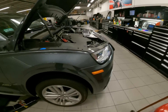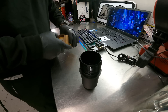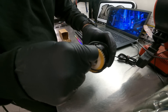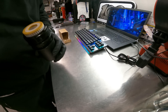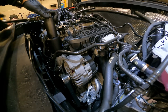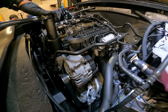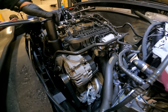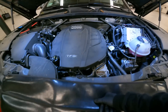We walk around the vehicle top to bottom, make sure all the lenses are good, all the gaps are good. One of the most important things on every oil change: make sure you replace the O-ring — always. Now this is a plastic oil filter housing going into a metal housing. You don't want to over-tighten this. There is a torque spec, but when it stops, just give it a little and that's it.